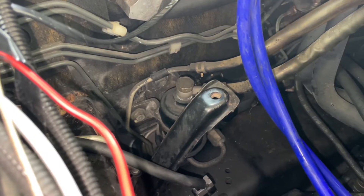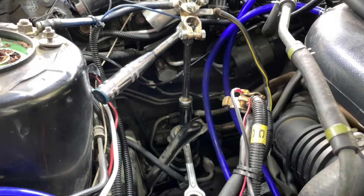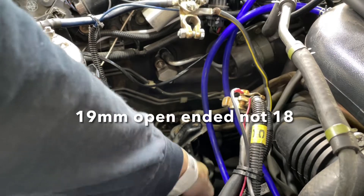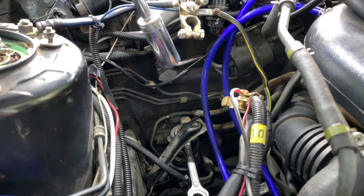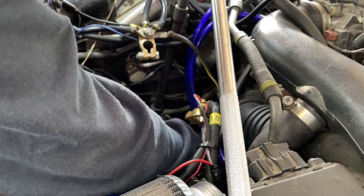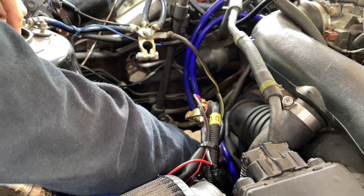Here is the fuel filter and boy is it down there. The fuel filter has the fuel output hose on the bottom. If you see this loop down here, you have the fuel input. The next step is to loosen the top banjo bolt — this is a 19 mil. This is going to be on quite tight, so take an 18 millimeter open-ended wrench and slide it in. Use that to hold the fuel filter still while you crank on the banjo bolt. This is just to stop you from ripping the firewall in half — I just have to resist it. Beautiful.